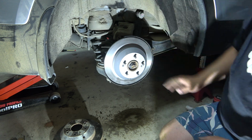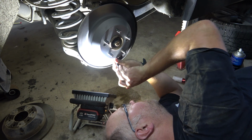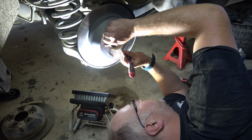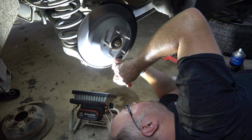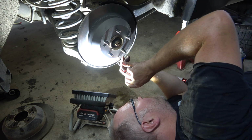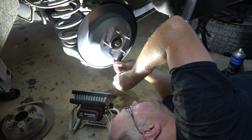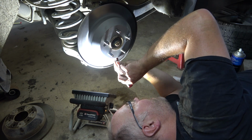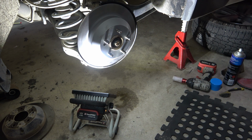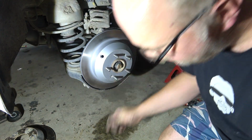Right, then we need to adjust our handbrake. So our wheel turns freely there, so what we need to do is tighten. One more. Right, that's locked solid now, so I need to back it off 5 turns. Or 5 clicks. Not 5 turns. That feels about right. Now we'll just draw a handbrake. Alright, so the handbrake's adequately adjusted, and then we'll pop our bung back in,